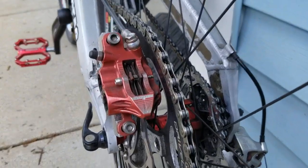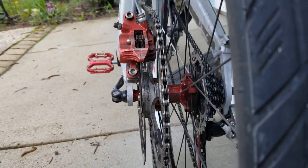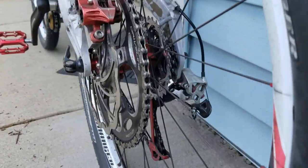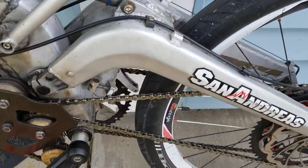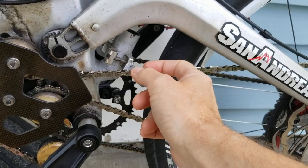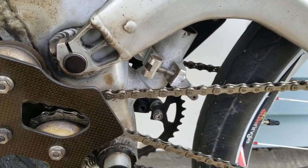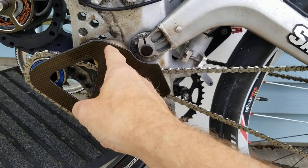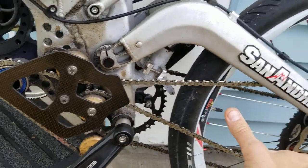That electric drive sprocket is sandwiched between the brake disc and the hub. I manufacture my own adapter — a machined piece that steps the sprocket over three-quarters of an inch to get the chain closer to the spokes and out of the way of the brake caliper. They call that a top hat adapter because from the side it resembles a top hat. I use a normal bicycle chain — typically a BMX chain, though in this case a derailleur-style chain works better where the BMX chain is a little wide. I also spin skateboard wheels into idlers on the lathe. The top idler keeps the chain from hitting the pivot when the suspension travels up and down.